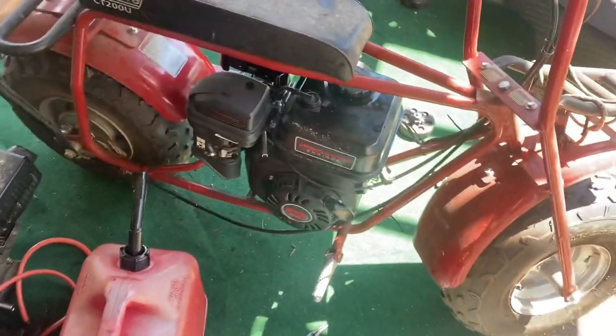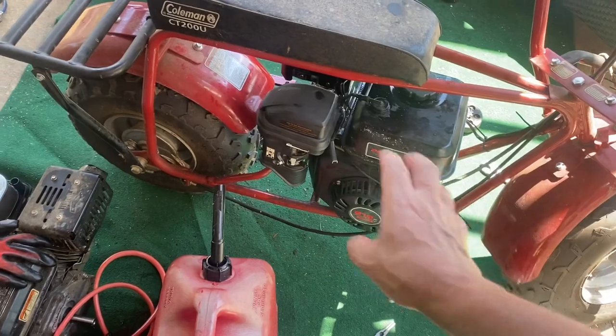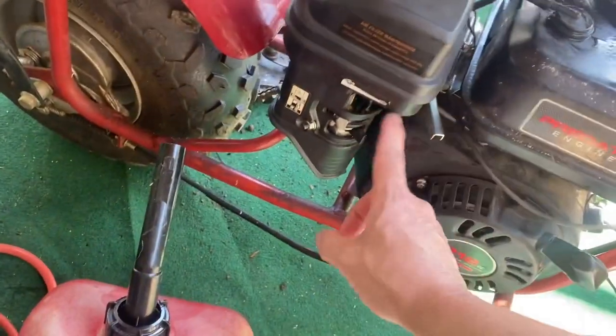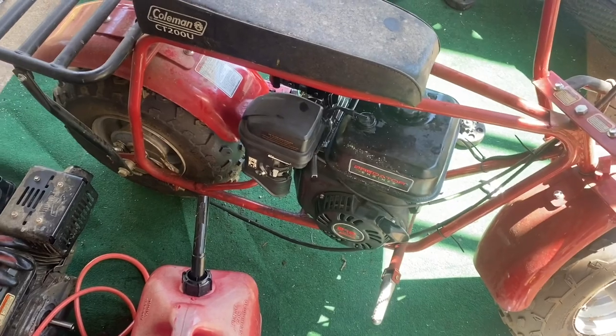together. Tighten down the motor. I got it running, got everything cleared up. It needs gas, too. It's so low on gas. But it is working on its own. No spray, no nothing. I had to clean out that part where it was coming into the carburetor. I had to clean the whole carburetor. It's been sitting a long time.